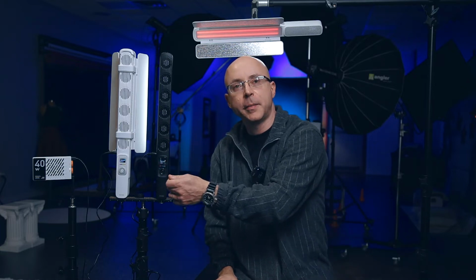Same exact thing that I mean here. What you should not do is you actually plug this in, connect it up to 100%, even worse to 100 watts of power, while the battery is actually attempting to catch up. At the same time, you'd be draining the battery. So when you unplug the battery, you can actually do whatever you want. Crank it up to 100%, 100 watts, whatever you want to do.